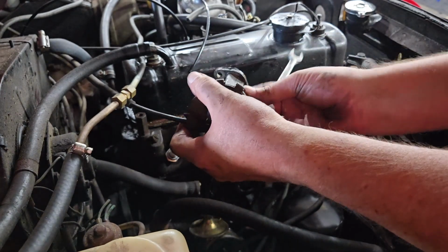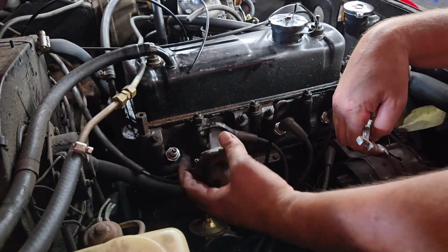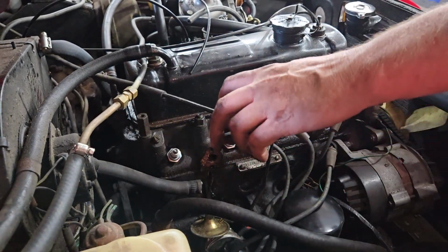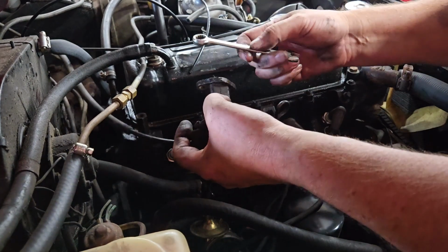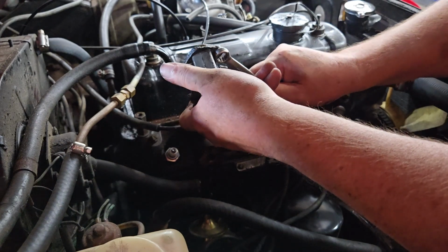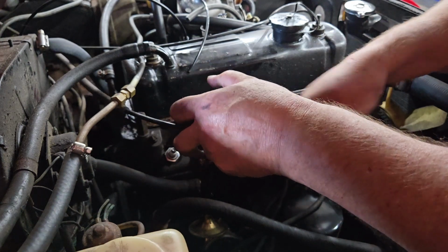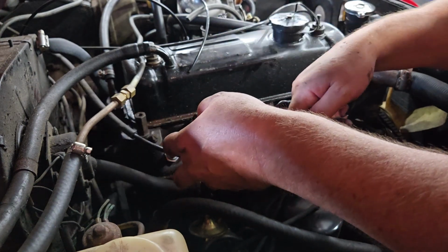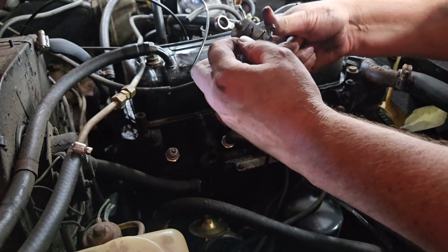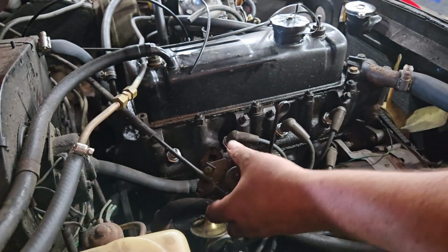So this bottom bolt is definitely a bit of a problem. Once you can actually get it loosened up and rotate the valve, you can get a better angle on it. Of course, I'm subject to the tools we have here, and this is the perfect size wrench, but the only problem is it's a little bulky on the box end, and that actually hinders it from seating all the way onto the bolt head. And it was quite tight, so I may have to run and get a nice shaved down 7/16 wrench that would probably do this job. So we'll get the rest of this out, and see, just got a jammer there. We've got to get that jammer out, and we should be able to remove that valve, and then we'll get the hose off there.